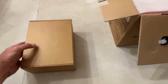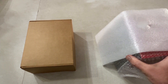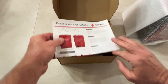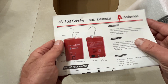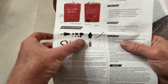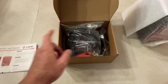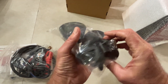You're going to get the parts box and the unit, all nicely packaged. Let's see what you get in the box. This should be all the caps. Of course, you're going to get the instructions. This is inexpensive enough that it's definitely worth getting it and trying this first before you take your car to the mechanic — at least to diagnose it yourself. You need to turn it on, get all the little accessories, plug it into your vacuum lines or your emission system, and you should get some smoke coming out somewhere. We're going to get all the little caps.